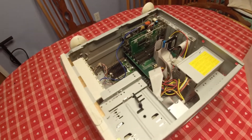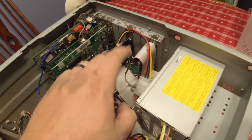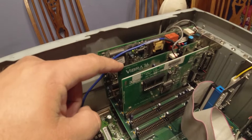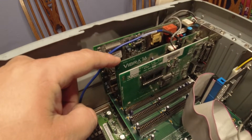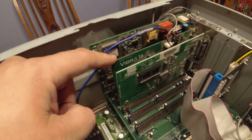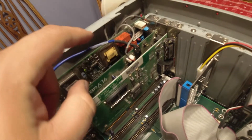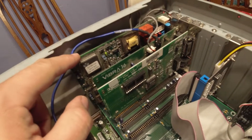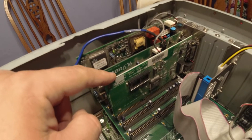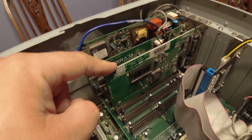Here's the inside of the machine. The original sound card unfortunately quit working, so I left it there and disabled it in the BIOS. This is a Sound Blaster VIBRA 16, model CT4180 — basically a cut-down Sound Blaster 16. I have it connected to the CD-ROM drive and to the modem, although we're probably not going to use the modem. Speaking of which, this is the original 28.8 modem it came with. And I've added in a 3COM Etherlink 3 10BASE-T Ethernet card.